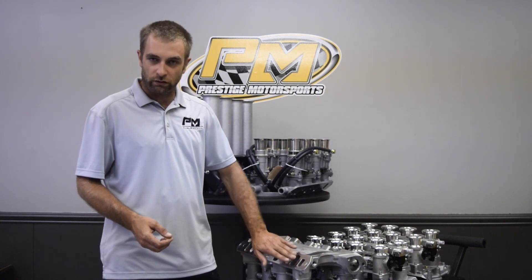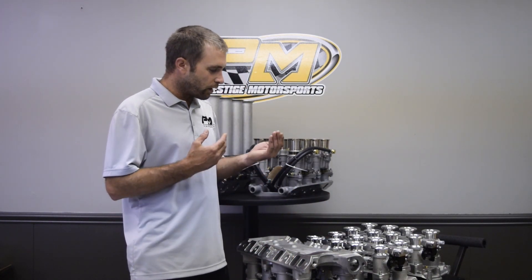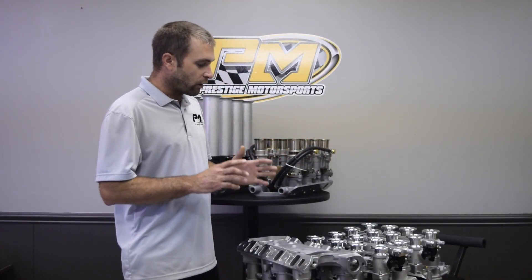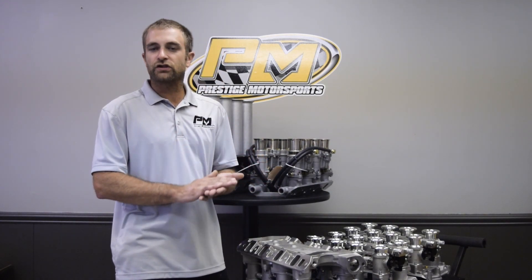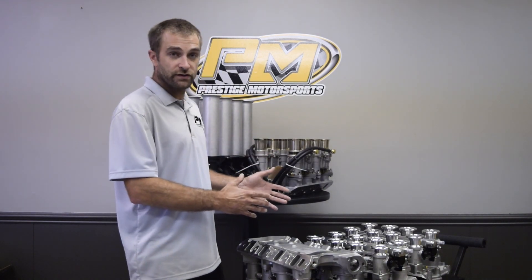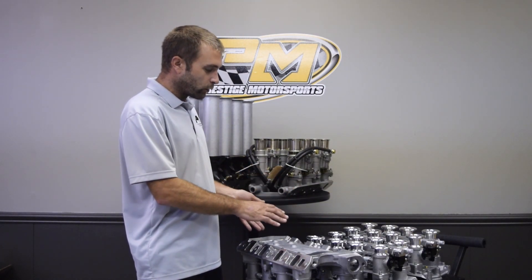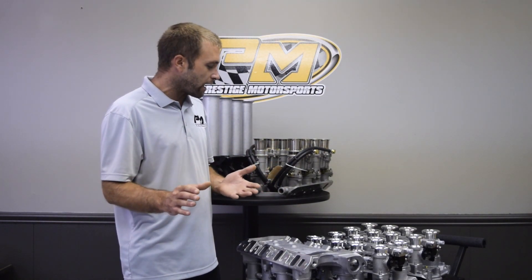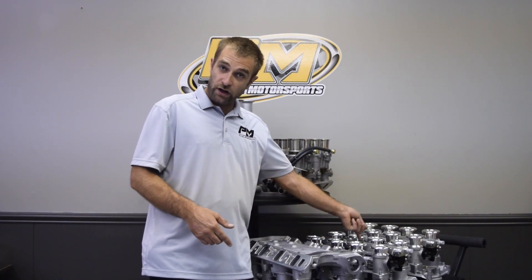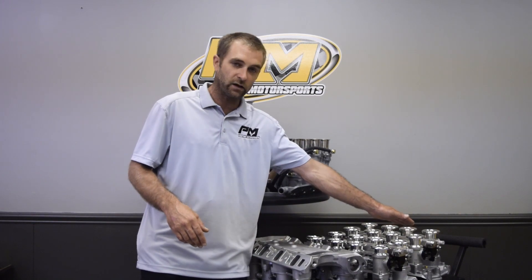Generally you have to remove these throttle bodies in order to install the manifold on the engine. Number one, we get a good line of sight of port alignment, which is very important to how well the engine runs. But when we reinstall the throttles, we have to readjust them, so we do a basic bench setting. When we go to the dyno, not only are we dynoing it with this system and the fuel injection system, but after all of our preliminary heat cycles and the first couple pulls, we go back and reset these throttles. It's very important because heat and expansion changes the base settings dramatically. If the installer wants to raise the idle, it's very important that whatever you do to one side of the adjustment is also done on the other side — because if we only adjust one bank of throttles, it's going to throw the other bank completely off.